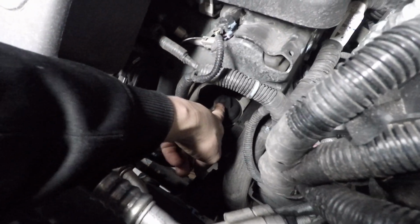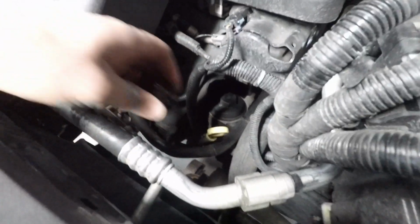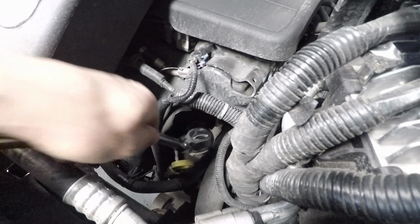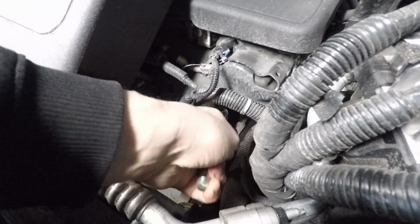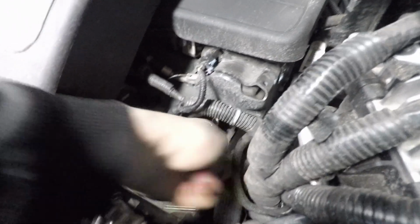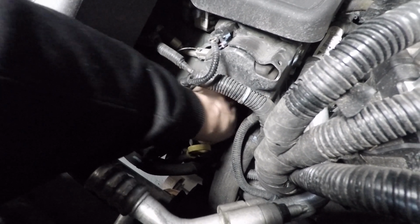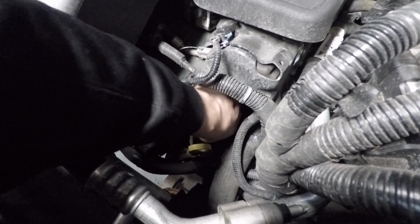As that's draining, we're just going to come in and undo this guy here. We're going to use that 32mm socket. If you don't have one of these, I'll throw a link in the description where you can get one. You can see it is kind of tight in there. That's why having a pivoting head on your ratchet will make your life a lot easier. Once you get it loosened off enough, you can usually go in by hand and finish it. Keep in mind you are going to have some oil in here, so you may want to have a rag handy so it doesn't spill everywhere.